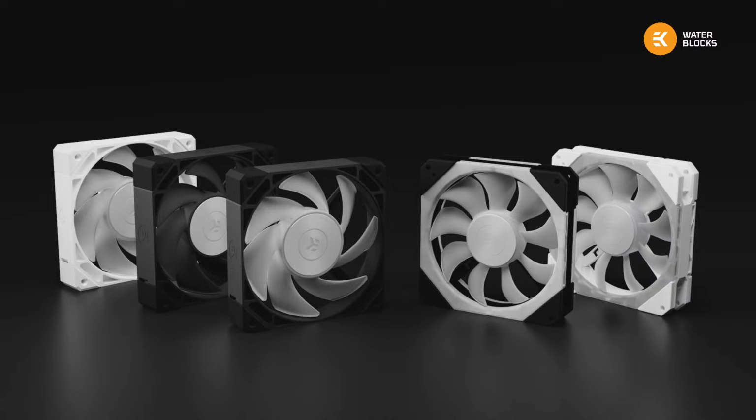So we will have a special connector for each fan with 8 pins, not a proprietary, unstandard connector, but a standard connector between each fan that's latched. You'll see which one as they come, and each fan will have a male and a female connection that is the exact length of the fan, and when you add a subsequent fan, they just plug together. Then you can choose the right length or right type of extender to either link 2 fans back to the individual fan and RGB header on the motherboard, or a whole series of 20 fans, even directly to the power supply and to a PWM control.